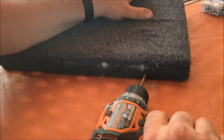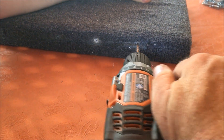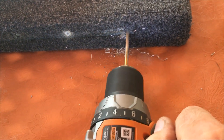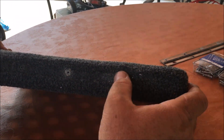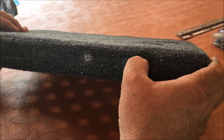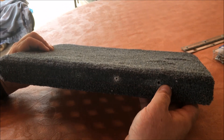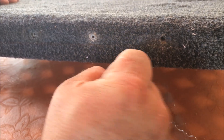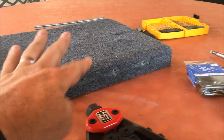For the most part you should be able to get it. I just lay it down flat and come in with the drill. You want to go sort of straight here, because if you go at an angle you'll wind up drilling into the hinge body, which you don't want to do. That one's out but it's in there a little bit, so I'll work with it to get it to come out. Sometimes they wind up inside there and it's just a little piece — that doesn't usually cause trouble, but you can work your drill back and forth to pull them out.